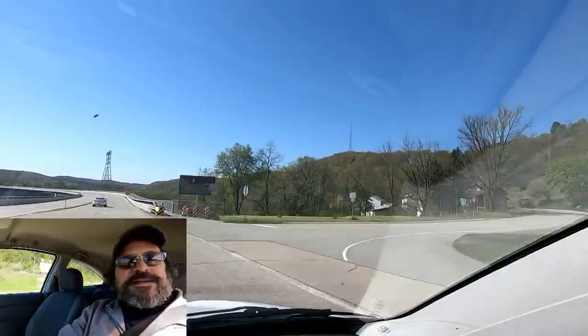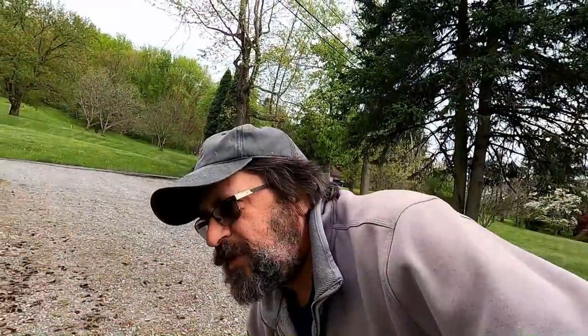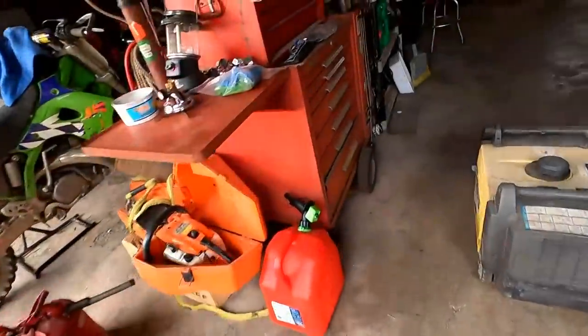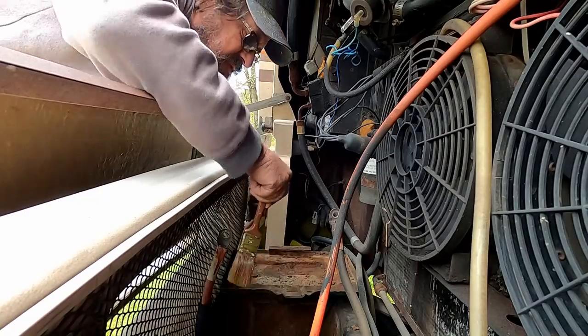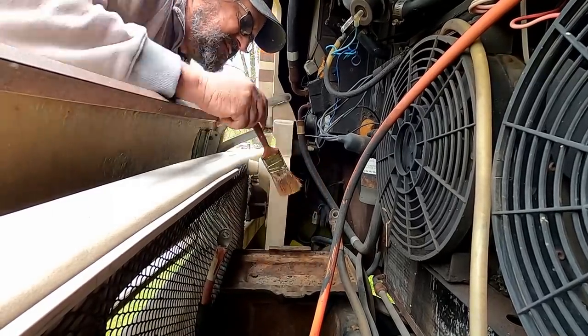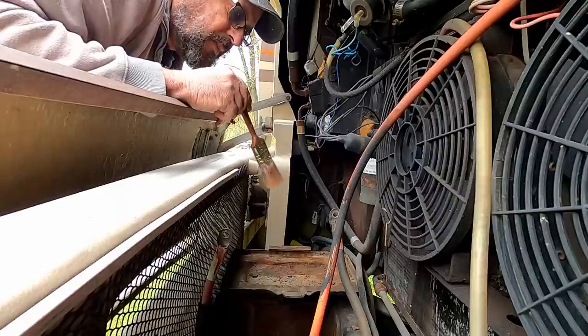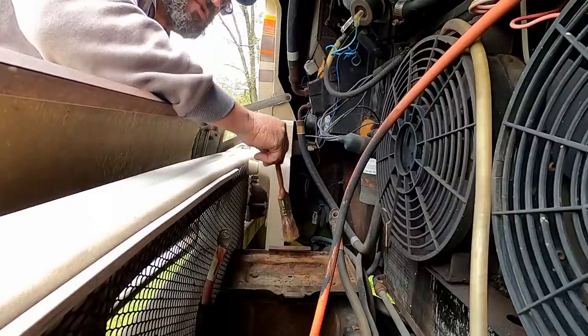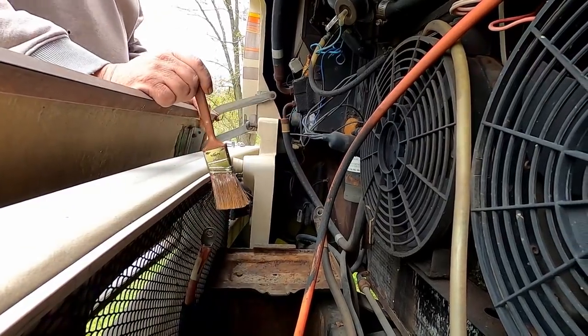The trees are starting to fill in really nice. Okay, we're back to the garage. I'm going to put this battery in — I'll set it on a piece of wood for now. This battery tray had a little bit of loose rust in it. You should sweep any loose debris out of these things before you put the new one in. Old battery trays are really bad about rusting out. Most auto parts stores carry whole replacement trays and all the hardware to mount the battery securely.